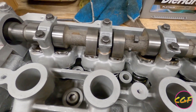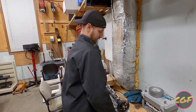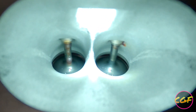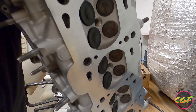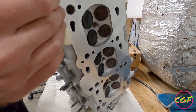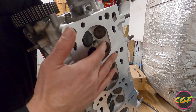They're 72-pound valve springs with titanium retainers. I had my guy at the machine shop do a five-angle valve job — you're not really going to see it too well — but these are stock valves and they've got a five-angle valve job and a back cut. The back cut does is when air or exhaust is passing over the valve, it creates a smoother flow path. Of course, he surfaced the whole head.